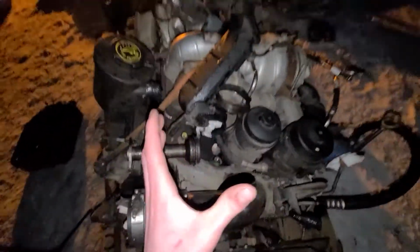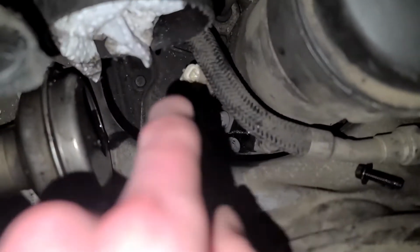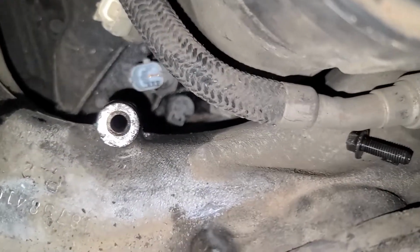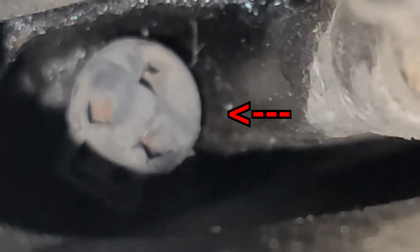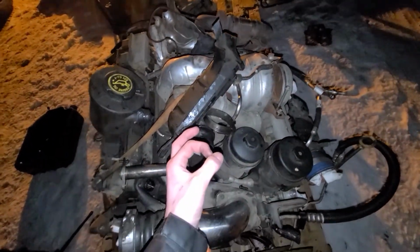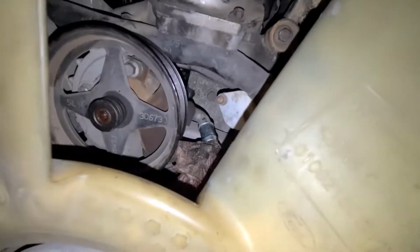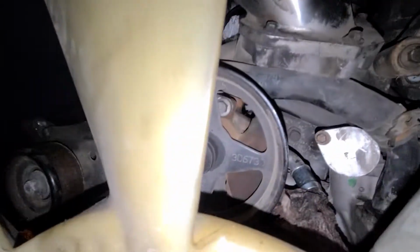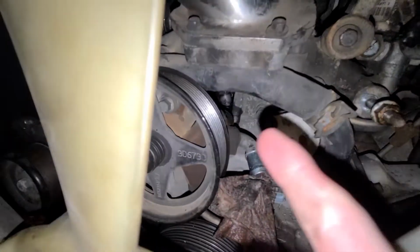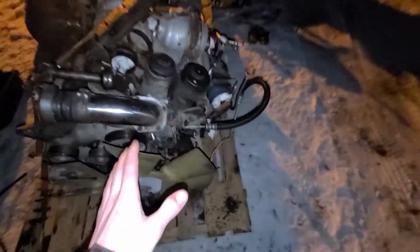So, anyways, wiring harness was pretty easy. Again, there was another painful spot right here by the turbos. Deep inside here, there's these two little plugs right there, and right there. And then deep inside, you see that little guy right there with the 3 holes? That's actually another type of Christmas tree clip, but it just goes onto a threaded nut. So if you look down here, the only way you can get to it was right here. And it was just up in here somewhere. Needless to say, it wasn't fun doing it, but she's off.